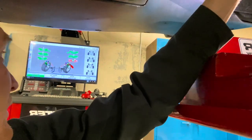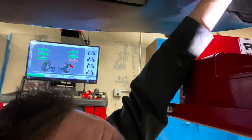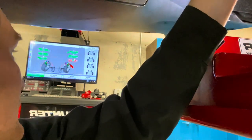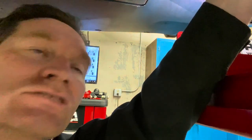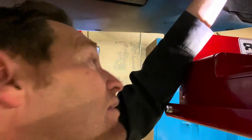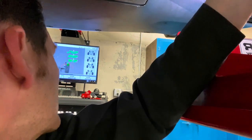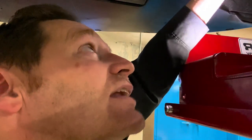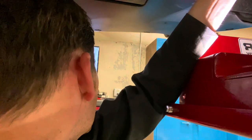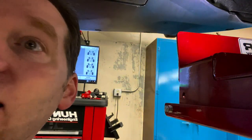Got my screen back here. I can see that red bar I'm trying to address — we're going to be adjusting the toe. I like to actually run a tiny bit of toe-in; I'm staying within the factory spec, but going to the inner edge of that spec because the vehicle feels more steady at speed to me like that.